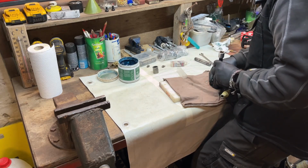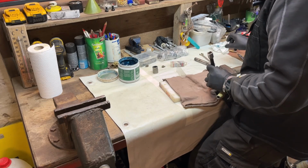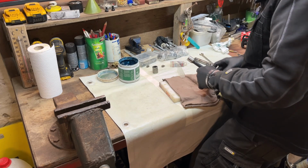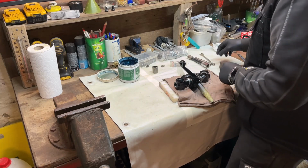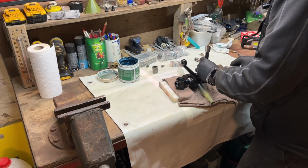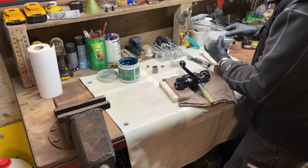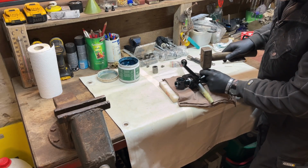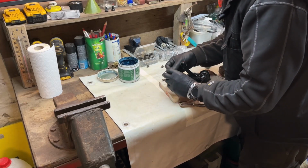And make some damage. Nope. This is better. Don't know the other side. Yeah, it's a little bit too high, of course. Okay. Now we can tap it little by little. And of course, if you don't have a socket with that size, you can always use your old bushing that's flatter than that socket, and that's in place. Now the other one, the same with that hole